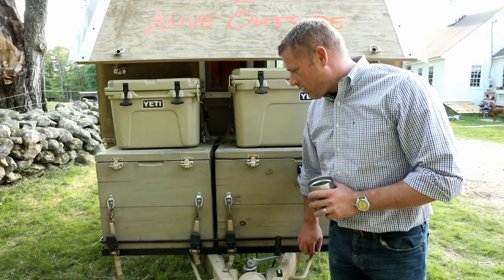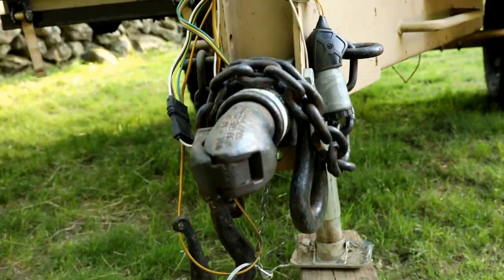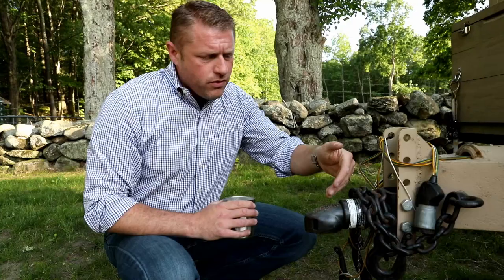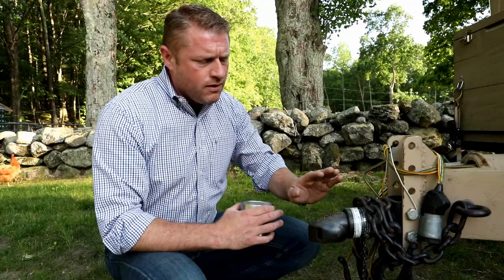There's a rack that would normally slide into the hitch on a truck, but I took that part off and just bolted it down permanently. On the deuce-and-a-half trailers they come with a pintle hitch, which isn't very smooth — it clunks around and it was heavy — so I cut off the front wheel and the front pintle hitch and welded on a standard ball hitch. I like this style because it's very clear when the ball goes up inside and closes. With the other style, the tongue can sit on top of the ball and look like it's on but actually come right off. In my opinion this is a safer hitch.